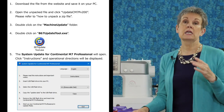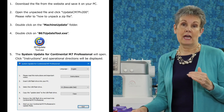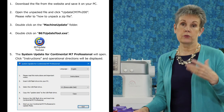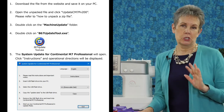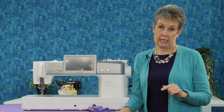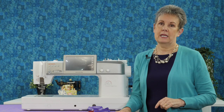Once they're in the computer, there are a few file folders. You're going to double click them until you see an EXE file. Once you've gotten to that step, you're going to double click the EXE file. It's going to run through some program stuff — just do it. That is going to actually transfer the appropriate files for the update to your USB stick. At that point you can eject the USB stick and you're ready for step two, which is actually updating the machine.